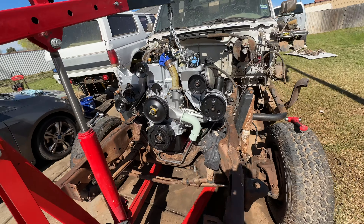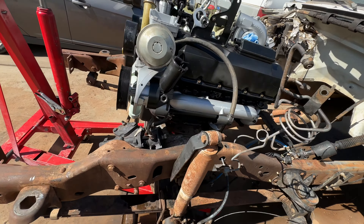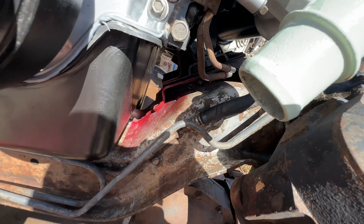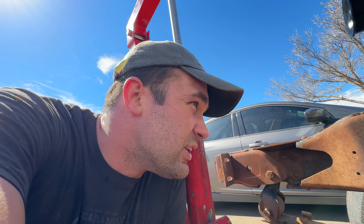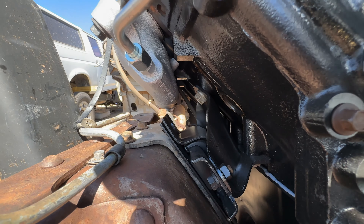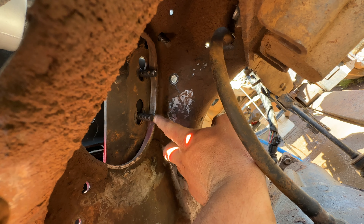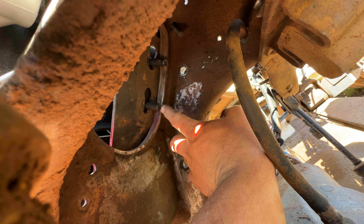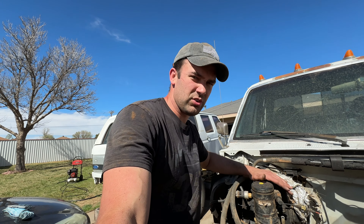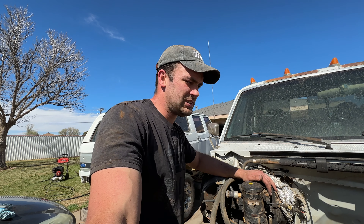There she fits — finally. After building her for a while, now she's in. It looks like down here everything kind of lined up. I threw some spray paint in here so you can kind of see where the bracket is supposed to be, so we sort of know where the holes are supposed to be drilled. This side looks perfect, everything lined up. But I think we're going to have to cut up here because I can't even fit my finger between there and the bolt head, so I'll have to cut some of that out to clear space so we can put our nuts in there. Other than that it's looking pretty good. I honestly thought there was going to be more to this than just setting that bracket in there and finding its home — it's pretty exciting.